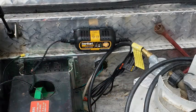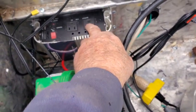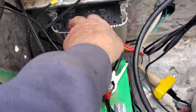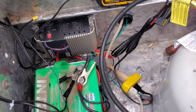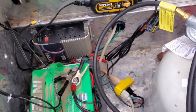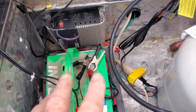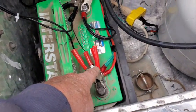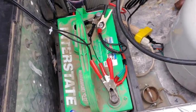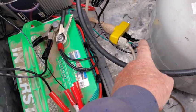Now if I pull in somewhere where we got electricity, this little charger here will charge up the battery. If we're off-grid and we need some 110V, we got this little outfit right here that I can turn on and it will feed the electrical inside the trailer camper. You've also got another plug-in out here if you need to charge up some batteries for your tools. It's all hooked up — this is all your positive side, that's your negative side over there. If we want juice in the house, just unplug that one.